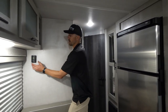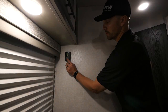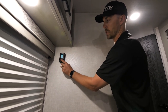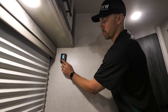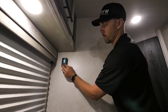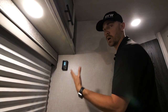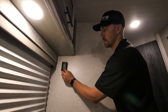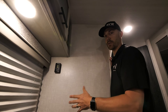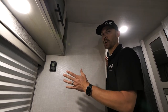The thermostat works just like one at home. The rectangular mode button cycles through: Off, Fan (which brings outside air in), then Cool (air conditioner) at high or low speed, then Auto which runs off the actual thermostat, then Heat which automatically kicks on the furnace — no pilot to light. When you shut the furnace off, the fan will continue to run for about 20 seconds to cool down the fan motor, then it shuts off automatically.